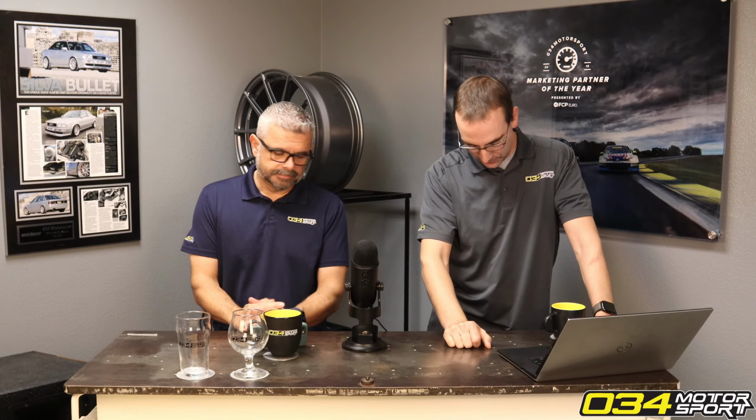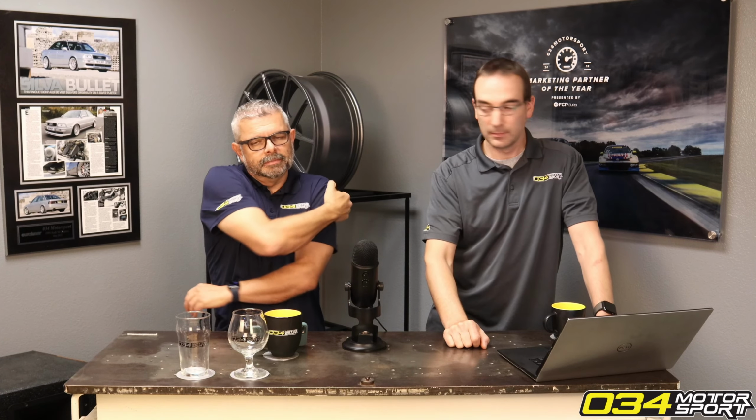The problem is catalytic converters can fail because of tuning problems and issues as well. And then the B8s in general are just grueling on all catalytic converters. Yeah, the OEM ones fail left and right. But did it fail after 50,000 miles or 2,000 miles? We need to know more information. There's only one reported case. And GESI weighed in, stating that the manufacturer of the downpipe didn't use a large enough core for the heat that is being seen in that application.